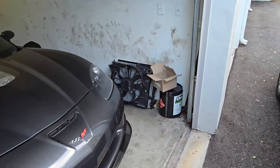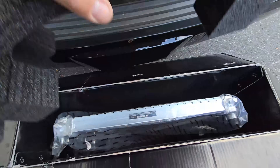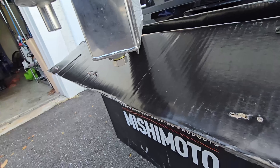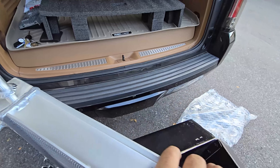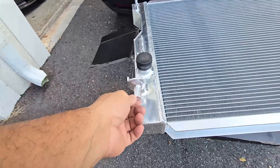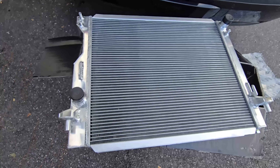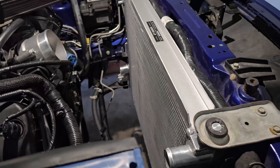A lot of you told me to reuse the GT500 radiator but because of the hose connections I'm good. I upgraded to a Mishimoto radiator — nothing wrong with a little upgrade. It has a direct fit. It has GT500 or S197-specific mounting situations — that's where all the hold-down bushings go, and on the bottom there are mounts as well. Let's slide it in, make sure everything works before putting hoses on and adding fluid. And there she is, installed right on the mounts.